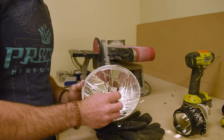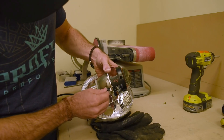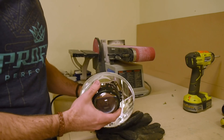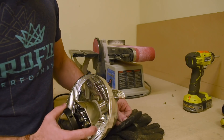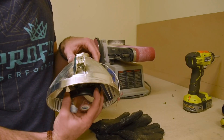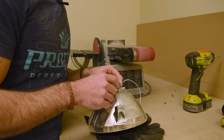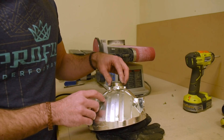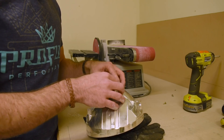The bi-xenon wiring is through the reflector through the little access hole. Next, plug that in and make sure it's nice and tight. I have the silicone washer already on the back of the projector — you will need that to dampen vibration. Put the projector through from the front side. From there, put on your washer. There's a little slot that lines up with the notch on the top of the projector, giving extra surface area to clamp down on. In an H4 application like this one, it also does the alignment job for us.